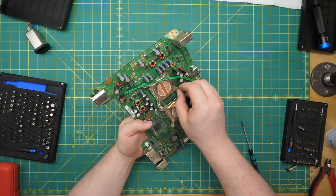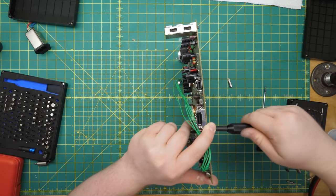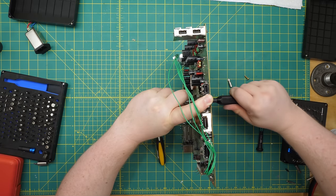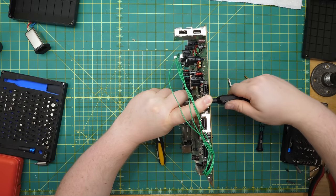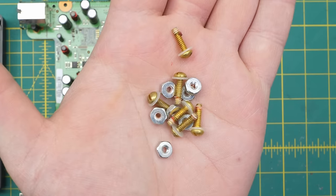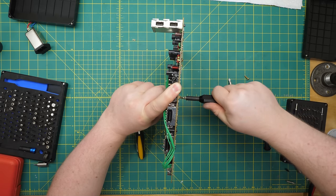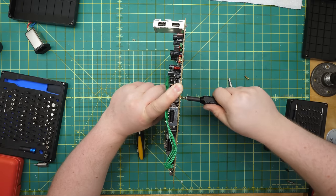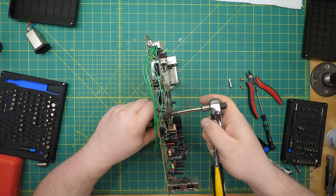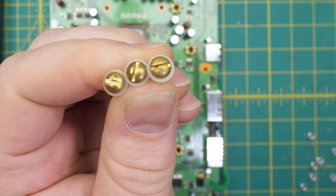I now had to get the copper slugs off the CPU and GPU, and Niveus used nuts and bolts to hold the brackets on, so I had to use a socket wrench and a screwdriver on opposite sides of the boards at a very awkward angle. They'd also put red Loctite on everything, and since that's meant to be more or less permanent, I had to put a ton of force into these fasteners. And the hardware they used was literally garbage — the screws are slot heads, which is the worst most slip-prone head, and they're made of brass, the softest material you can make a fastener out of. This was a nightmare: I rounded out at least three of the heads, my driver nearly slipped and gouged a hole in the board every time, and one rounded out so bad that I had to go get a pair of vice grips to hold it in place. I ultimately got everything out without any damage, but the fasteners were just cooked. They're literally cabinet hardware — intended for looks and nothing else.